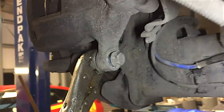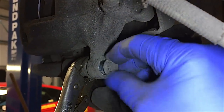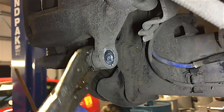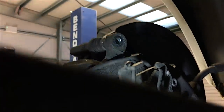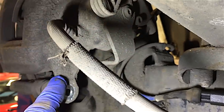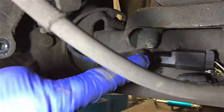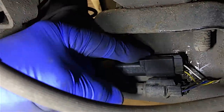I've had to put the phone down to undo the bolt. Now it's loose — that will come out nicely. We'll get the top one out as well, same way. That's both our bolts out now. There's one other thing: there's a brake pad warning sensor on these pads on the passenger rear. So you've got to disconnect the plug connector. There are two wiring plugs here — one's ABS, and one's for your brake pad warning sensor.